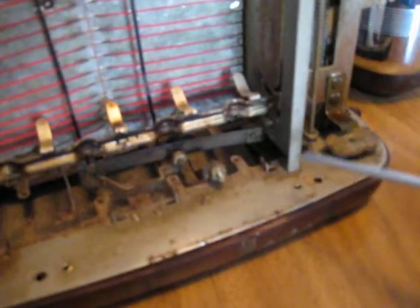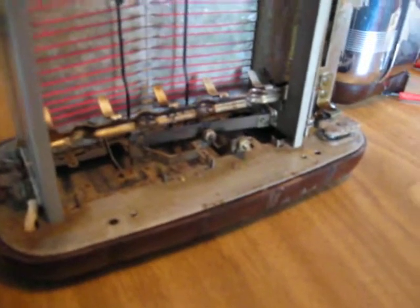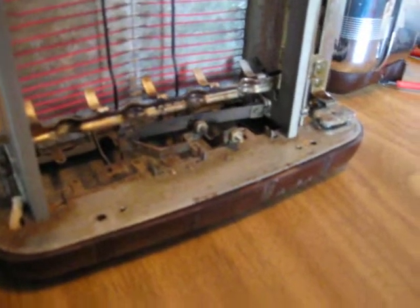Trying to get around where you can — this isn't the best camera to do this with. But there's a little stud that comes out the back side of the timer, which that bi-metallic strip pulls on. And what that does is, as the toaster gets hot, it makes it to where it will make a consistent piece of toast, because each time you use the toaster it's heated from the time before, and so the amount of time it needs gets shorter.